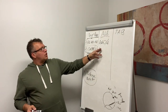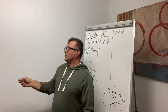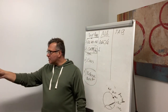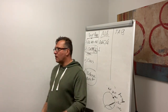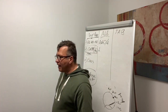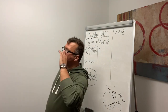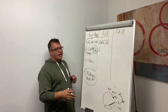Okay. What you need to do, you will need to fan your brake, drop your pressure until you see what? Not until 55. This is important: until you see the buzzer and light. So 55 is part of the explanation. Yes, numbers are okay. But you fan your brake until you see the buzzer and light, not until 55. Sometimes it's 55, but the buzzer and light did not activate. What are you going to do? So you're fanning until you see the buzzer and light.